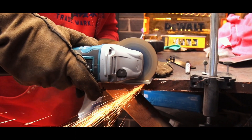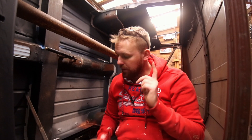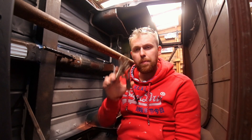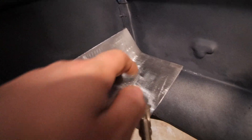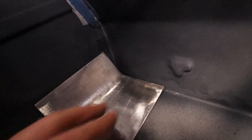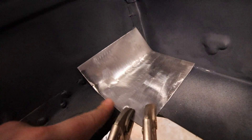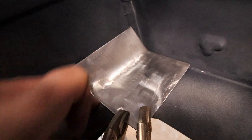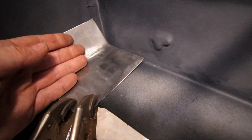We're back inside the car. I've got the bit of metal with me and we're going to try and get it into shape using some mole grips, a hammer, and of course a bit of a knocking stick. As you can see it's slowly taking shape. What I'm trying to follow is the contour of this piece here, so when I push it down I can cut that back, scribe it, and get it all into shape, then shape it around the door where the mole grips are. I've left it overlapped because I need to cut into this piece to butt-weld the two together, then flop this bit of the floor back and slide it behind, because it's supposed to go behind and not in front.